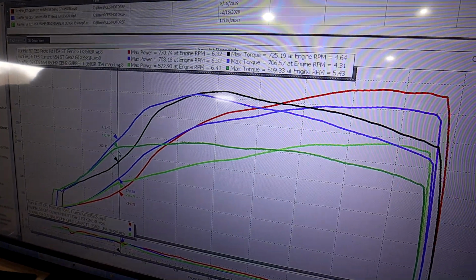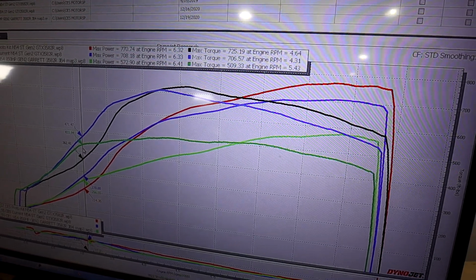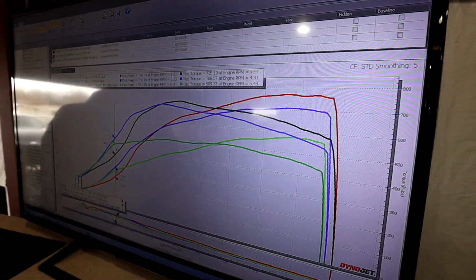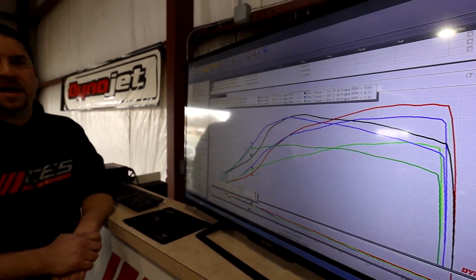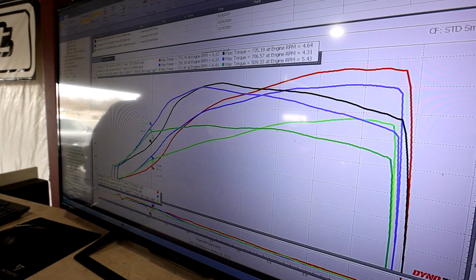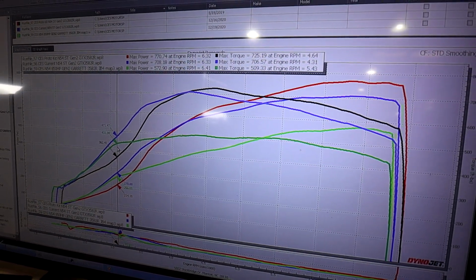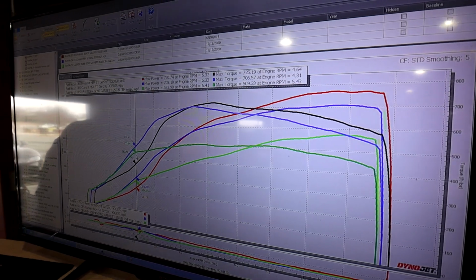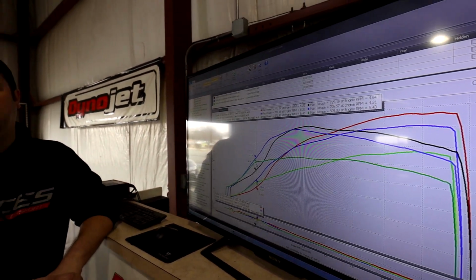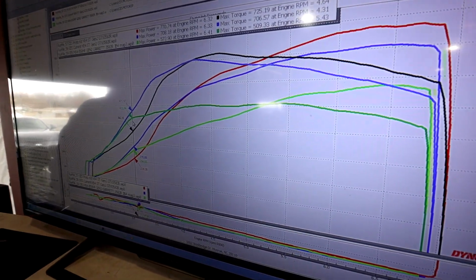So if you're running the E85 tune and you run even lower boost levels like this, you're still making 570s at the wheels, 500 torque on a generic map that we haven't even touched to increase any spool, power, torque, or anything. If you throw a JB4 on the car, you throw our kit on the car, you throw a low pressure fuel pump on the car, and you run E85 PI, you'll get similar results, and that's just baseline numbers basically. What do you say we go for a ride in one of them? Sure, yeah, let's take a spin.